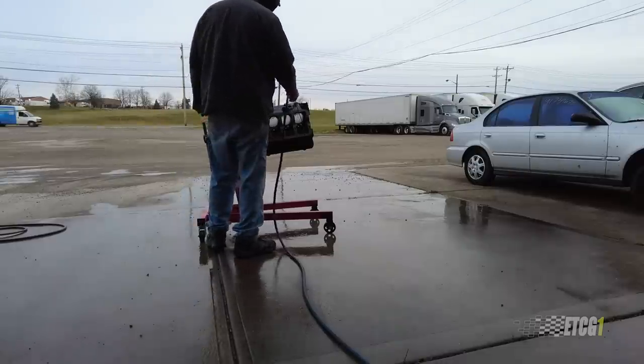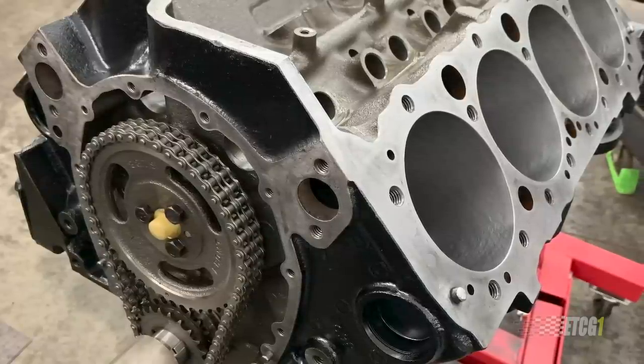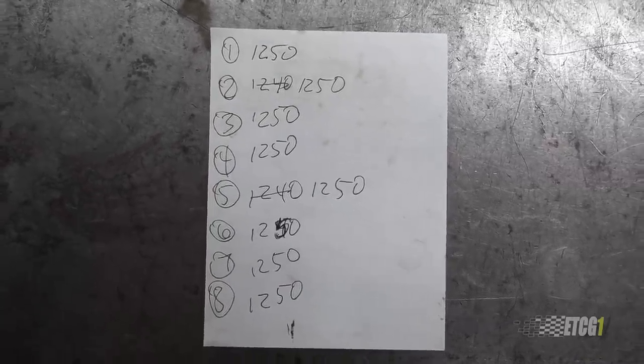When I brought it back in, I washed the cylinders with soap and water again to make sure no metal bits were left over. I continued this process until I could run a paper towel up and down the inside of the cylinder with no metal residue on it. After that, I applied touch-up paint to areas I had ground down, then coated it with WD-40 to prevent any flash rust. Finally, I was ready to reassemble the bottom end. I installed the crankshaft, the rods and the pistons — all in the correct locations with valve reliefs correctly placed. I checked the weight of all piston and rod assemblies and they all weighed the same.